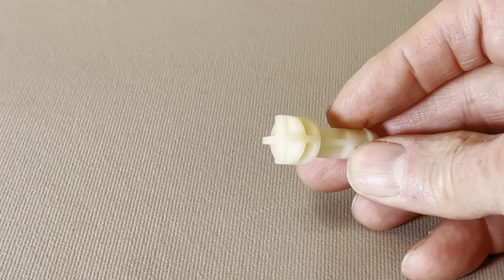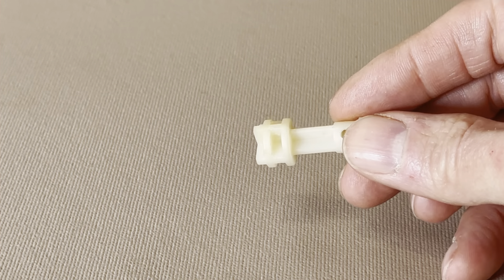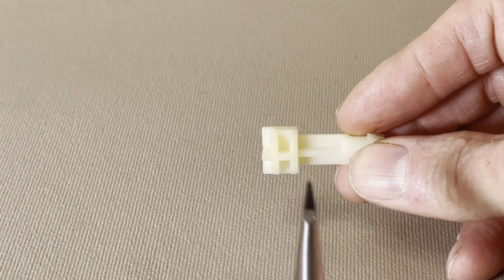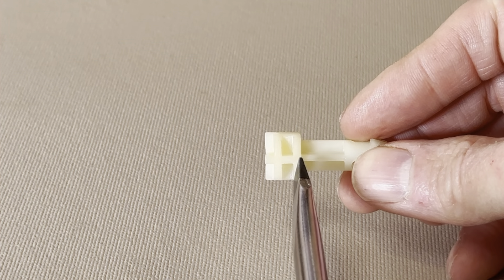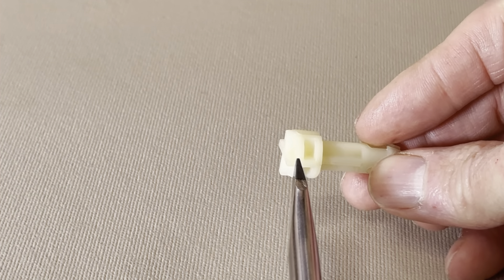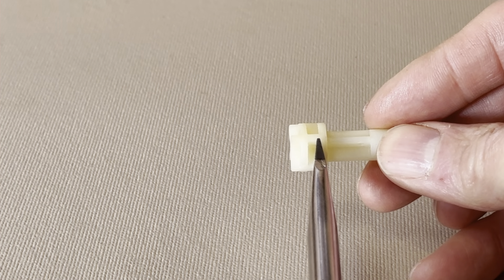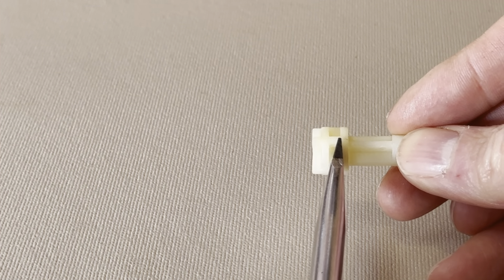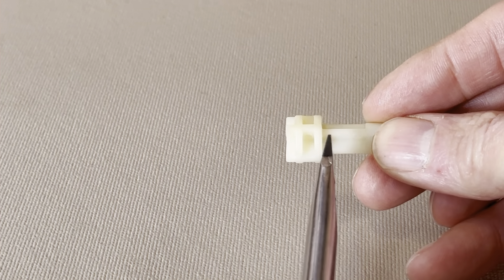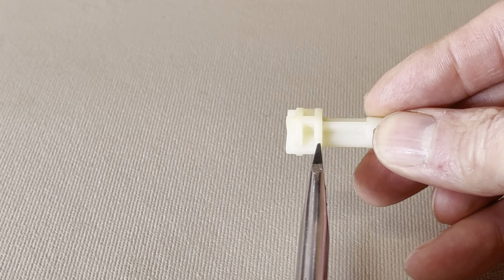This is probably a really good time to take a very close look at the anatomy of that nylon bolt. I've taken the spring off so that it's much more clear, but this bolt is what you see peeking at you between the wall of the fridge and the freezer door — it's part of the hinge assembly. When you insert the screwdriver to push the bolt into the wall of the fridge, the first time you do it, you're probably pressing against this disc here.